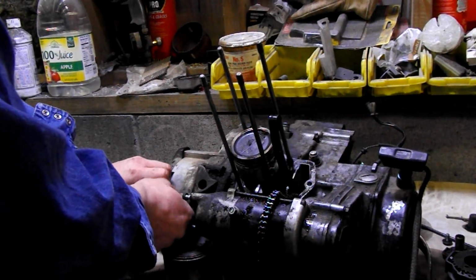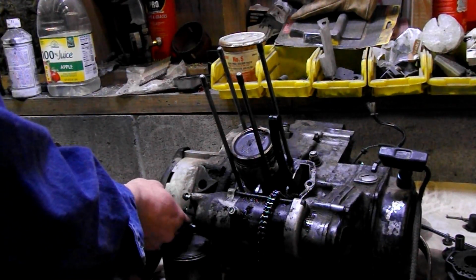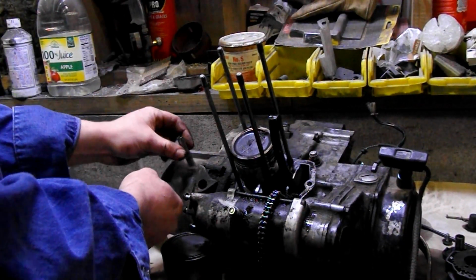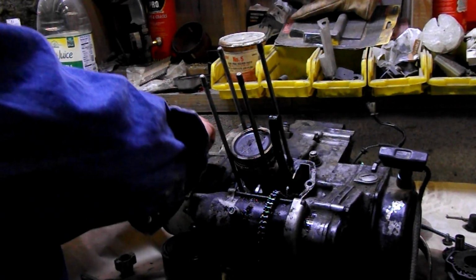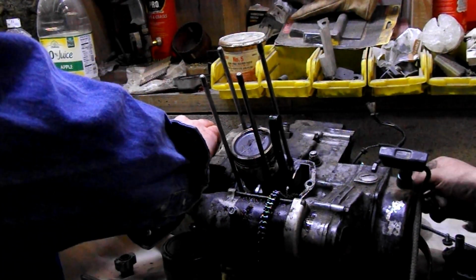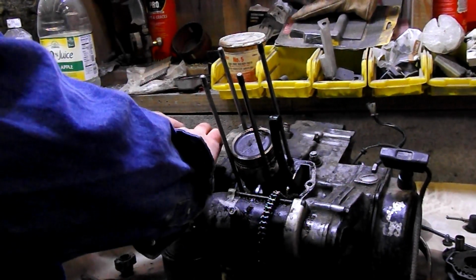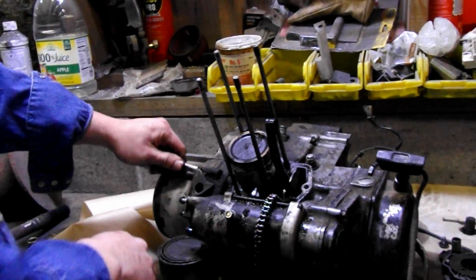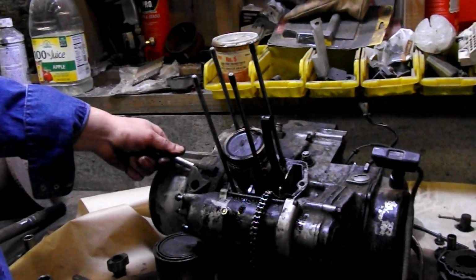There's actually two different clutches. There's a primary clutch and a secondary clutch. You might have noticed that as you're driving, if you hold the shifter down or up, you'll be, in essence, between gears. And if you give it a shot of throttle in between there, it's going to rev up and not go anywhere. That's because there's a secondary clutch to keep the gears from grinding. There's a primary clutch for when you're at a dead stop in gear, so it won't just lurch forward like a stick shift car.